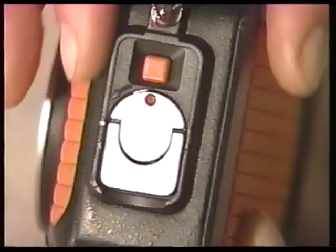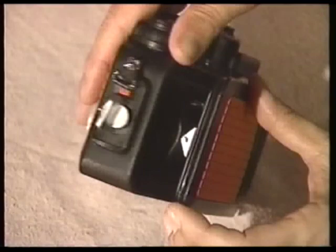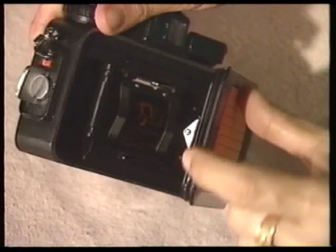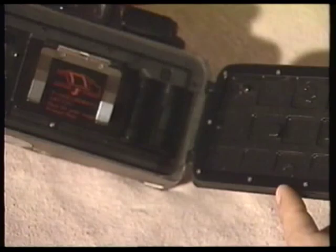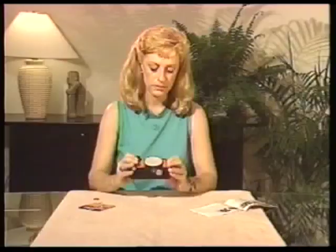You'll find a camera back release lock latch and an orange lock button on the left side of the camera. While pushing the orange button, twist the lock until the red lock mark aligns with the white index mark. As the rear compartment door swings open, you'll notice a slight pressure outwards caused by the black rubber O-ring. This O-ring provides a waterproof seal and is similar to several others you will see on the camera's strobe head. We will discuss the proper maintenance and lubrication of these O-rings in just a moment.